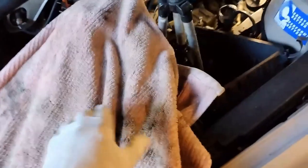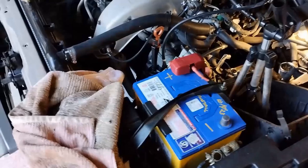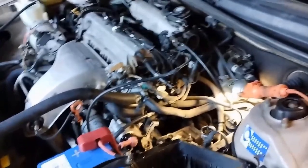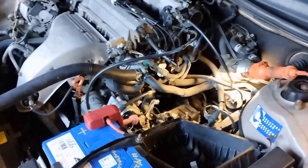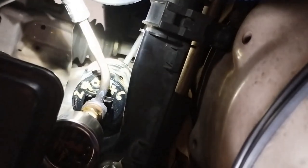Just to point out, my battery is covered and the negative is disconnected — I may have mentioned that earlier, but this is two or three weeks later. I need to reassemble to start the motor, just to do a visual test for fuel leaking. With the engine running for about 10 to 15 minutes, we can see there are no leaks — no leaks from there, and none underneath the car.